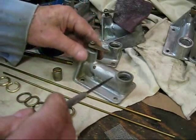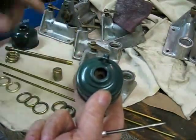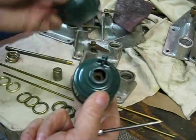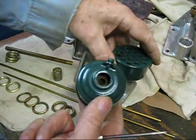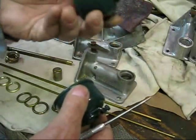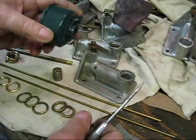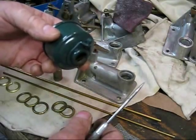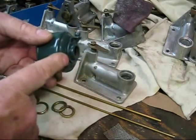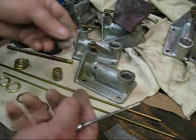Not all Maytag mixers had breathers in them. I have two types of breathers. This one has the set screw. This one has a ring around it that went inside the mixer as such. This one went in and you tighten the set screw to hold it on — this is the older one. Not all one-cylinder Maytag 92s had these. It depended on the kind of service the engine was installed in, the type of washer, whether it had a breather or a screen.